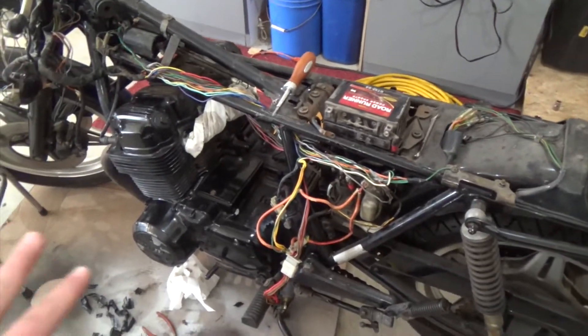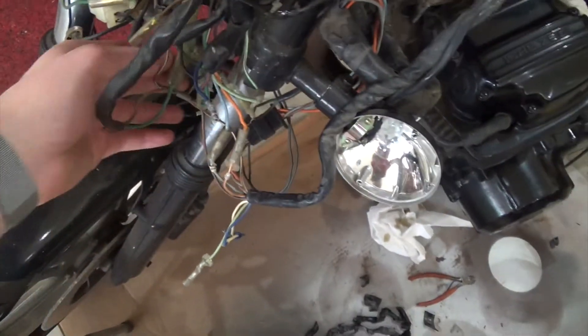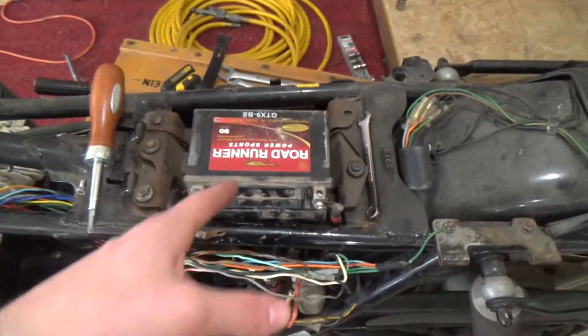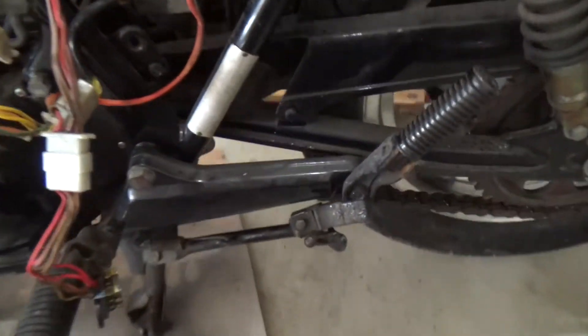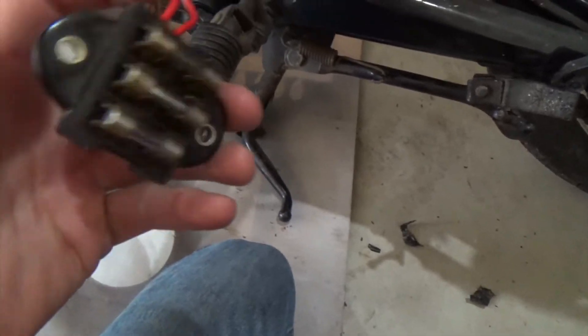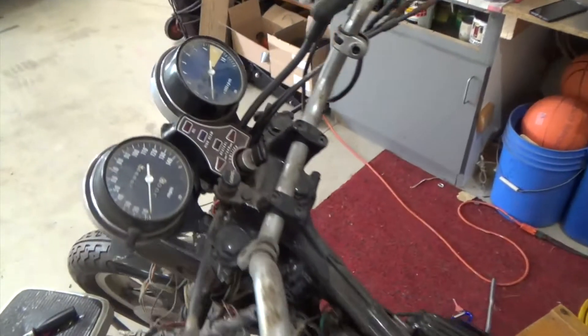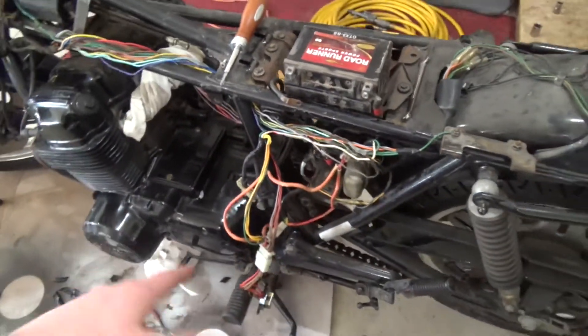So the motor has the oil all in it. Now my wiring — I connected it, it's really easy. All you do is connect it matching the actual colors. I don't have my headlight on here so I didn't do that. I grabbed a battery off my four-wheeler because I'm going to change this into a cafe racer and I don't want a huge battery. My biggest problem was these fuses. The guy I previously bought this from had the wrong fuse in the bottom and I wasn't getting any power to my ignition switch. I changed that out and got power — that was my whole problem. I was checking everything else on the bike and it was just that little thing. So the moral of the story is check your fuses first and make sure you're getting power to the main power sources. Once you get that figured out then you can start tackling other stuff.